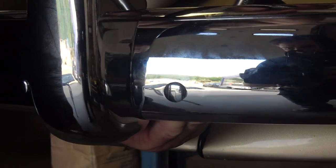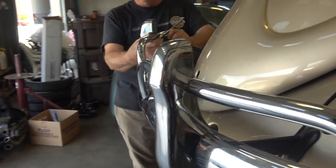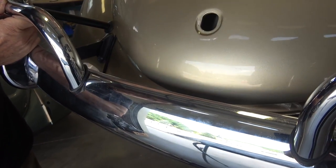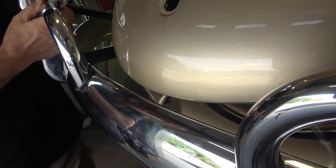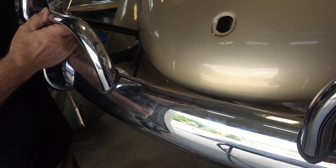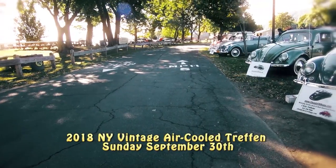Get your bumper bolts and start assembling and tightening everything down. Don't overtighten those bumper bolts because a lot of times they'll dent the fender — you don't want that. Do a test fit, test the lid — plenty of clearance now. There you go! Any questions, pop me an email, guys. Take care.